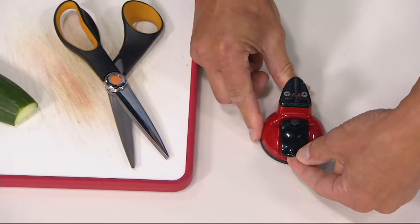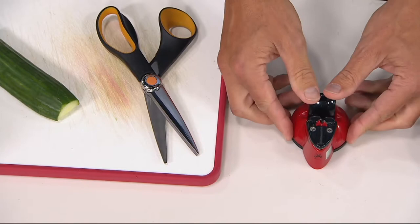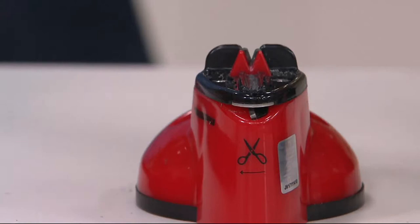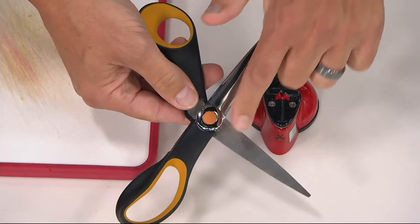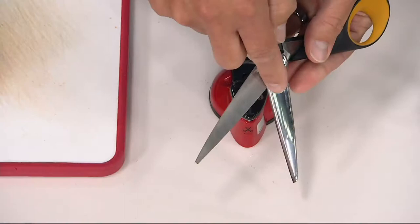To show you how easy it is to get off the countertop — you lift the clasp, it comes off. When we flip this around, you'll notice on the front there's a picture of scissors. This is our only sharpener that does scissors — one of the biggest requests from QVC customers. It has a little diagram so you know which direction to pull the scissor blade. Always put the flat side of the scissor blade up. Because it's secure, I can focus on just gently gliding the blade through the sharpener. A few passes, flip the scissors over, and do the other blade. Now those expensive craft and fabric scissors have a razor sharp edge, ready to go like brand new.